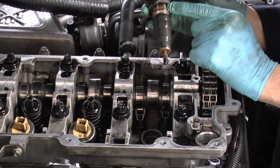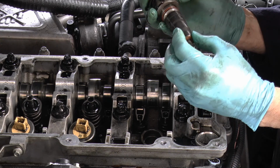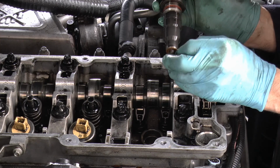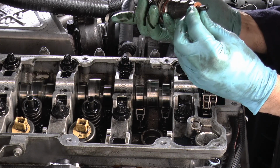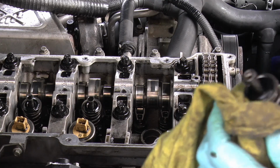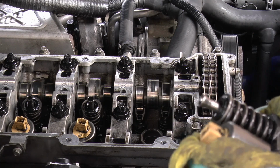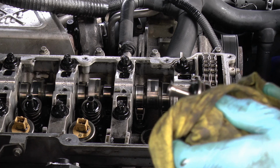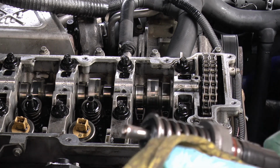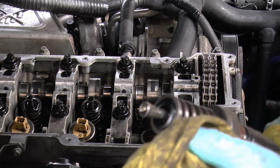Right, that's the seal. This is the red one, mine are green. Hope the colour doesn't matter. And there's the washer. That's going to come off. It's going to need a bit of persuasion by the look of it. Now the annoying thing about this job is it was only in March, it's December now, that the head gasket was done. And I assumed they'd put new seals on. Well, on the invoice there's no sign of any seal kits, so it would appear not.